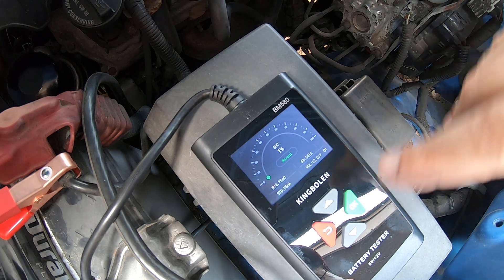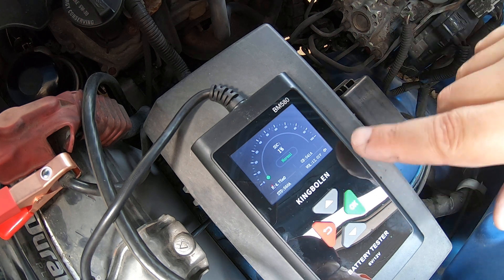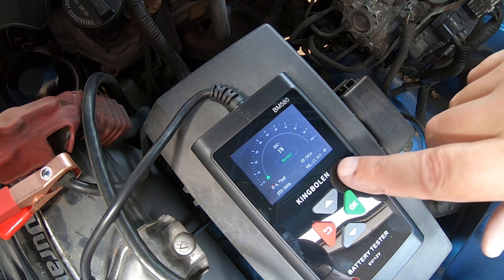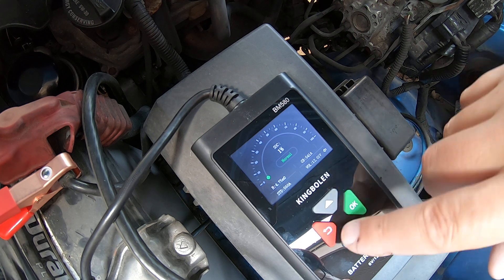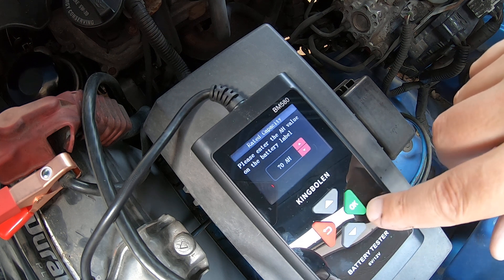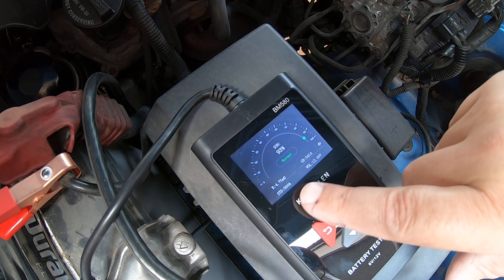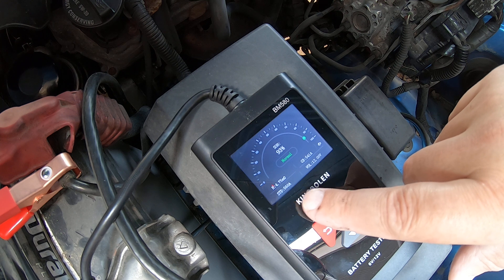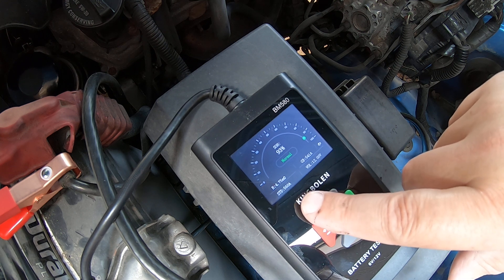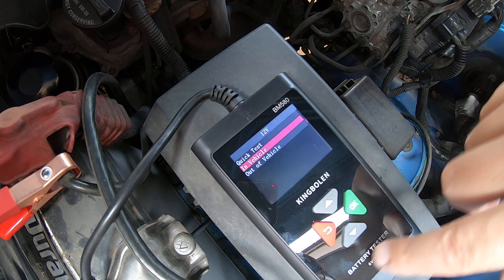It's been sitting about 45 minutes — I just moved it to this side of the driveway. It does have a dash cam with parking mode, so even with the vehicle off the dash cam continues to record. It's showing 12.01 volts, so the battery is getting weak. Going back in, you can see the resistance at 4.75 milliohms and the standard 560 amp reading.